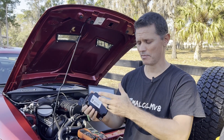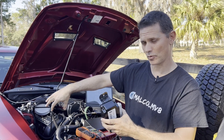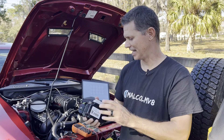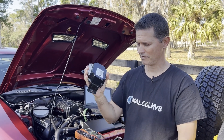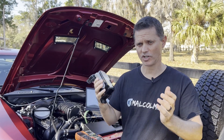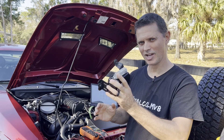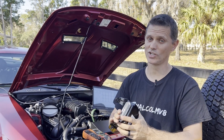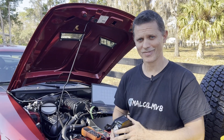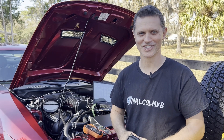I could have opened up the CCRM and modified the circuit board to make the same thing happen without putting a relay on the harness. The reason I chose not to is because it keeps stock parts completely usable — if the CCRM gives me problems, I can just pull it out and grab one off the shelf or from a junkyard, swap it in, and it works. The customizations are not in the serviceable parts you're going to be replacing. Hope you guys enjoyed that tip. If you like what you're seeing, subscribe, thumbs up, all that good stuff. See you guys in the next one, take care.